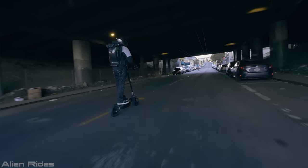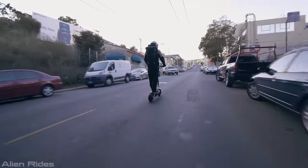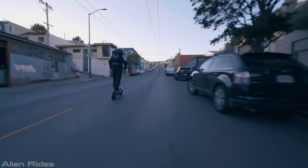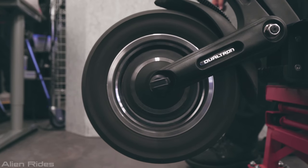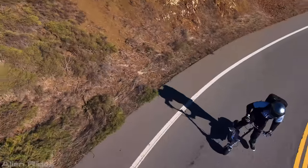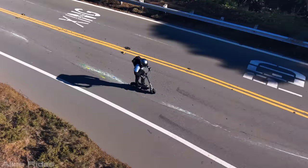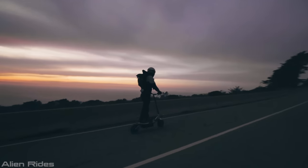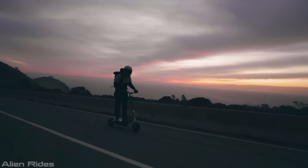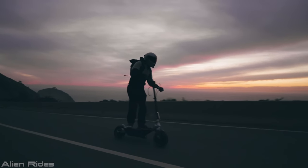I get a lot of questions around the feel of the ride with only rear suspension, and honestly it's totally fine. Millions of people have ridden smaller rental scooters with no suspension and get along fine. Many scooters with front suspension handle like garbage at speed and will get crazy wheel reverberation at higher speeds. This is a racing scooter — it's built to be connected to the ground and handle amazingly at speed. You can handle some bumps and even do some light off-roading if needed. Trampoline-like suspensions are great for off-roading; little to none is perfect for racing. Additionally, the frame flexes while accelerating to absorb wobble and vibrations, kind of acting like an invisible layer of suspension.